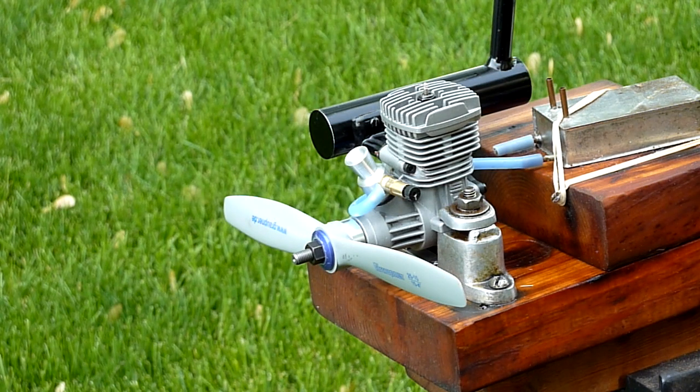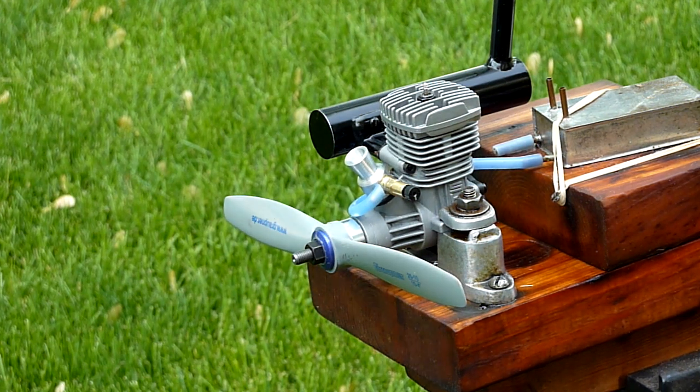Okay, here's a further test of the SH-37. I made a Venturi out of aluminum that accepts the main jet needle from the existing throttle that comes with the SH-37, so we're going to see how that works.